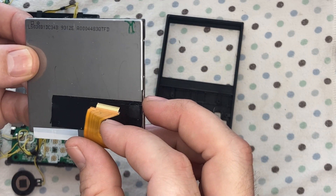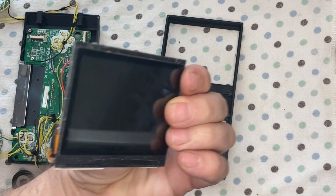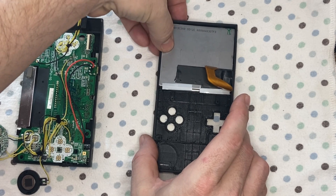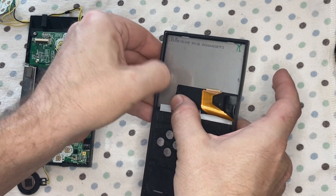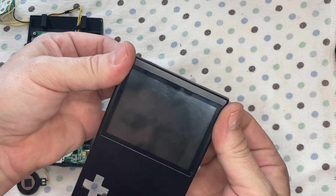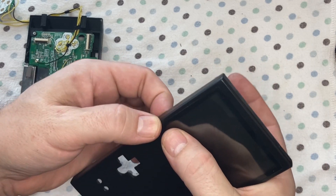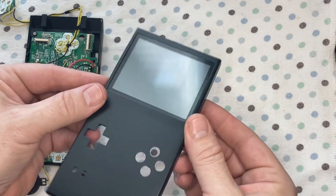Here's the screen and we're going to put it in. If you look right here, I cut the last three pins off — which would have been the audio pins. This is the upper screen from a DS Lite. Just very carefully snip those last pins off and it will fit into the lower screen socket, so you can complete this build without any ribbon cable extensions. Just finessing the screen in — there are some clips that snap in place. Making sure the front plastic lens is flush with the front of the unit. That plastic lens is from the DS Lite upper screen assembly.